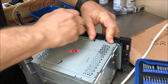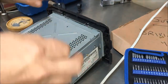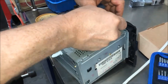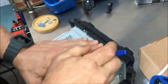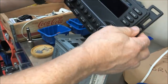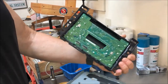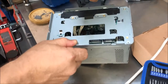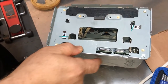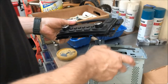See if that one stays up there while I'm doing this one. You can see that's released — we've got to go to the other side. This one's got a broken tab so that's easy. And voila. You can see the integrated circuit push pins here that go into an integrated circuit board down here, which makes it very easy for disassembly and reassembly. I want to caution you because some of these face plates are connected by a ribbon cable and not just a push pin setup, so when you pull it apart look inside very carefully to see if you have to release a ribbon cable, otherwise you could damage it.